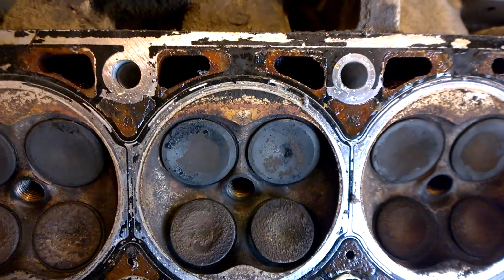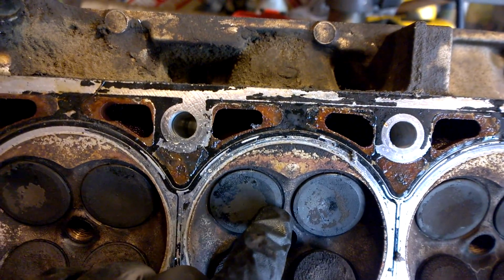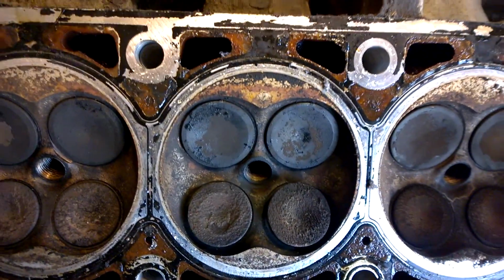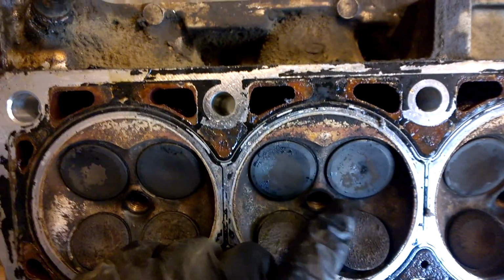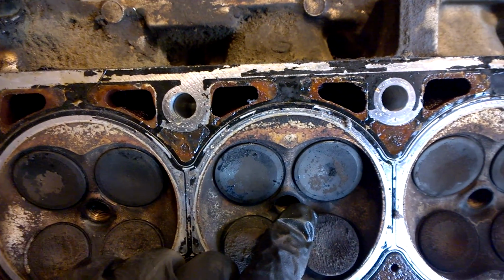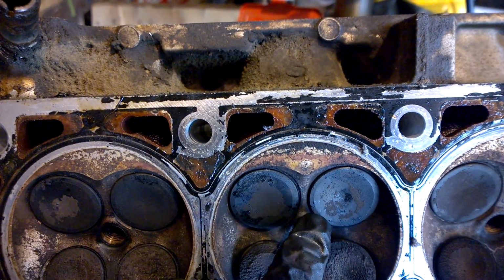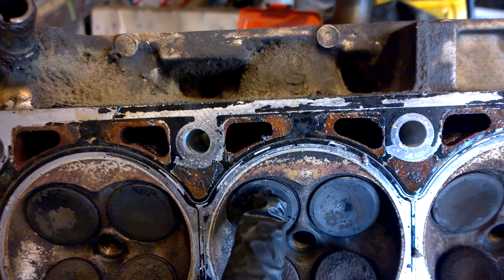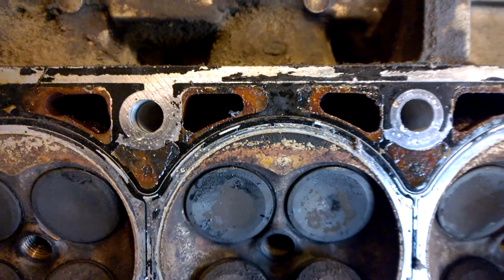The valve is tipped. That's the result of a close tolerance fit engine where these two valves were open when the piston came up. And the reason why it was open is because the gear was not turning in timing with the engine, and the valves came down, stayed open. The piston came up with them being open and hit them and then bent this side of them. It touched this side right here. You can almost see a little bit of a score mark right there on each side of it where it touched the piston.